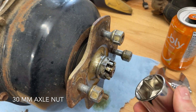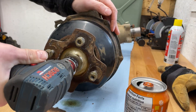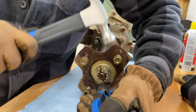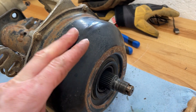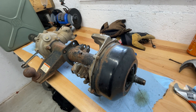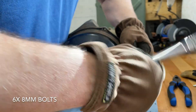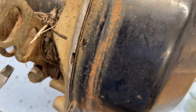There are no chunks of metal, no flex, none of these splines have anything wrong with them — it's just greasy. So I'm going to insert it back up into here. You've got to keep the swing arm tilted up so it'll fit in, and you've got to keep it centered because it's so long. Now that the axle is off, I'm going to jack up the front end, put it in gear, and let the front tire spin to see if the drive shaft at the very back of the motor is still spinning. I'm pretty sure it is, but I want to show you.